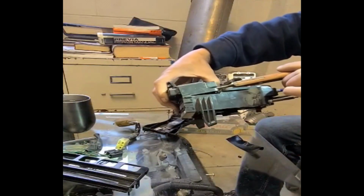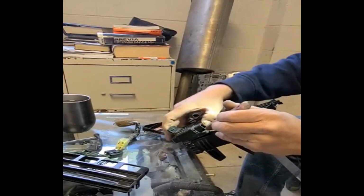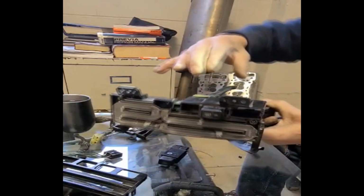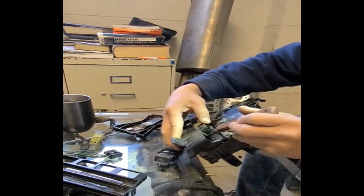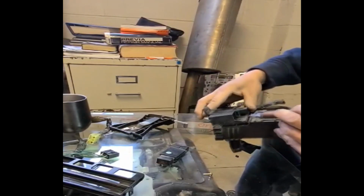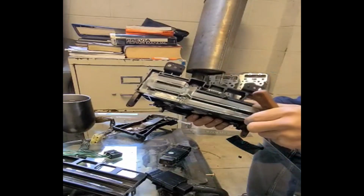That locks it in. So you have to take a flat screwdriver. You can get either way, like this. Just push it down and then push it back away from you, okay? That way. Same thing as the AC, the defrost switch. It's a clip back here. So push the clip down, just push it right out. Okay, that's it. And everything else like this here simply comes out like that.